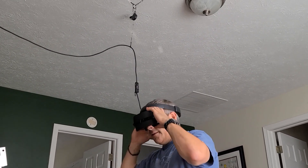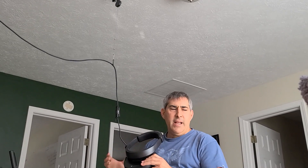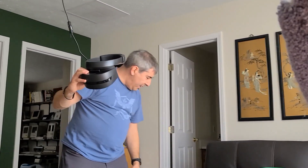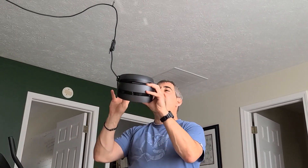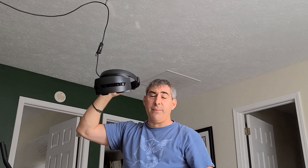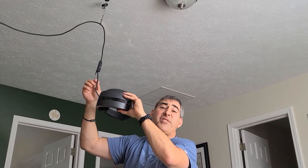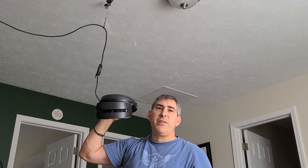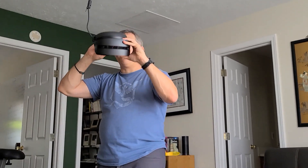There's a lot more freedom of movement now and you're not tripping over a cable. There's software called Turn Signal — it's free on Steam — that tracks how many times you're spinning so you don't fray your cable. This is a known issue on a number of VR headsets; the cables aren't always high quality and you're also twisting a lot which is bad for cables. Getting a solution like that might help, or just keep in mind how much you're moving. Make sure you don't get all twisted up.